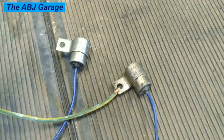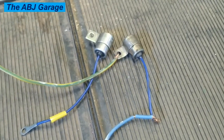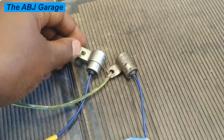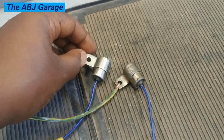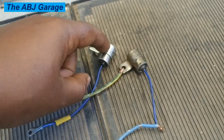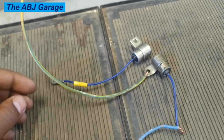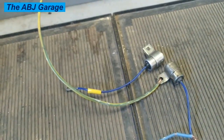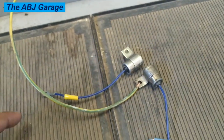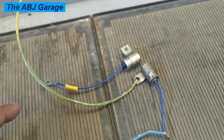This is how you can test the operation of a condenser capacitor on a test bench. You can also perform a similar test with a multimeter. If your multimeter has a capacitance measuring function, check the capacitance by connecting one lead to the casing and one lead to the positive terminal, just like we did here. You can also measure the resistance value — make sure you select the maximum resistance range on your multimeter so that the resistance will gradually increase and finally reach infinity.